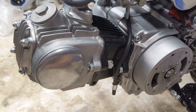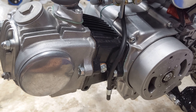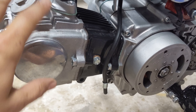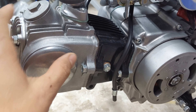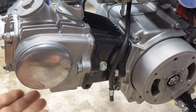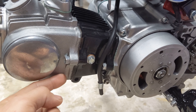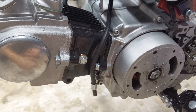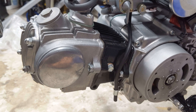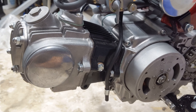Now that we have the concept of the oiling system addressed, let's talk about the real reason for the video: dry starting, which you want to avoid — especially on a fresh engine build or something that's been sitting a while. That oil that's been up in the top end from an existing running bike, if it's been put up for the season or sitting for weeks or a month, gravity feeds and falls down through the cylinder head, hits the return galley, and goes back to the crankcase. So it gets pretty dry up top, and I'm going to show you why you want to prime the engine to get oil pressure and things lubricated before you kick it over.